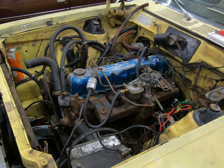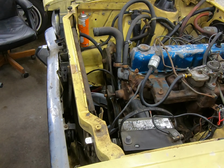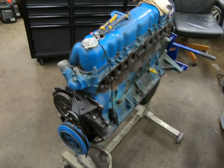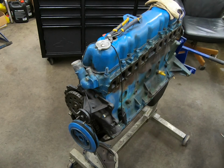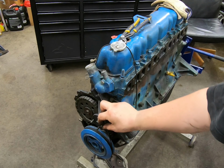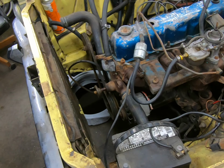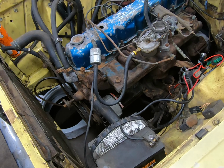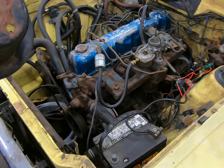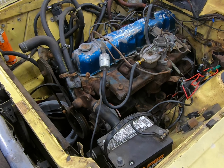And one of them is this belt pulley issue here, where I didn't have any bolts in there. So what I'm gonna do is, one of my older engines I removed from one of my 78 AMXs, 258 car, I'm gonna borrow the bolts off the water pump. I borrowed one here already, and I put it on the Gremlin down in there, if you can see it, and it threads in there. So I'm gonna use those studs, and that's how I'm gonna mount this flat the way it's supposed to be. And that should take care of that pulley issue.